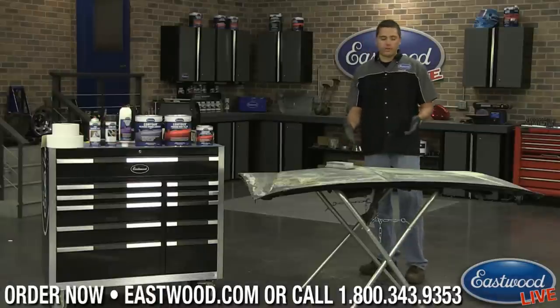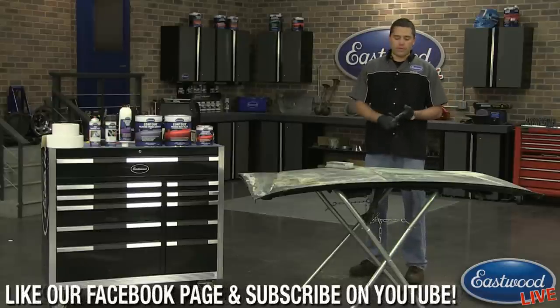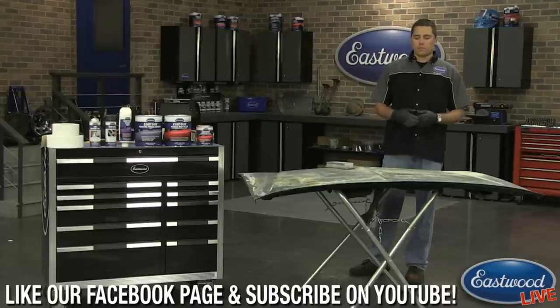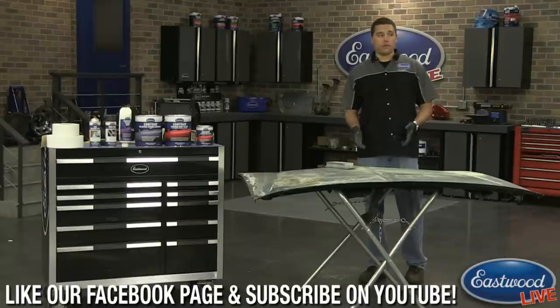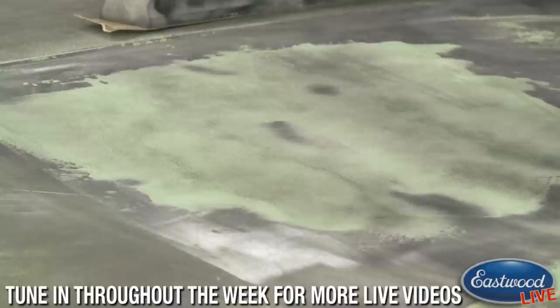I wouldn't, because almost all of your body fillers are going to end up a yellowish, greenish, or bluish color. So if you use a tan one, it could potentially get kind of buried in there. You don't really see it. The black, I've never seen a body filler that it doesn't show up greatly and really show you where you need to work a little bit harder.